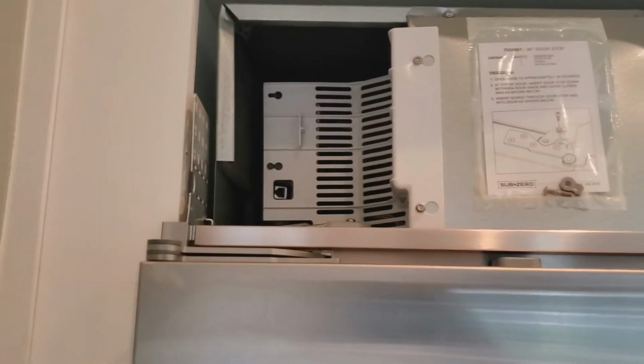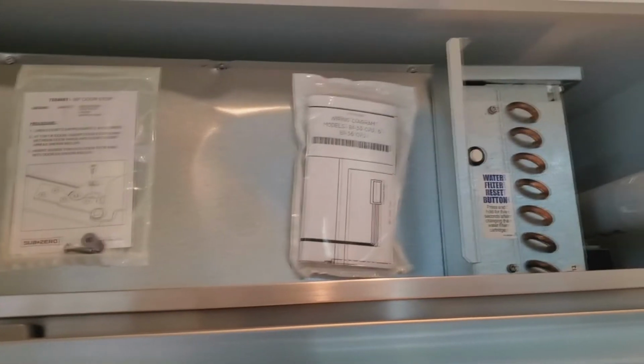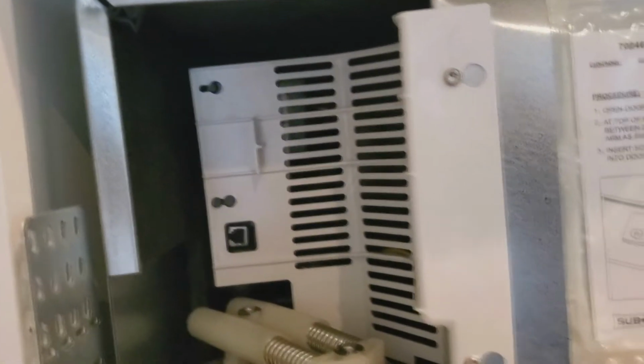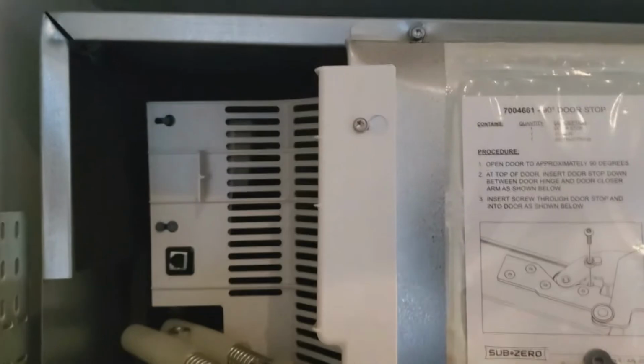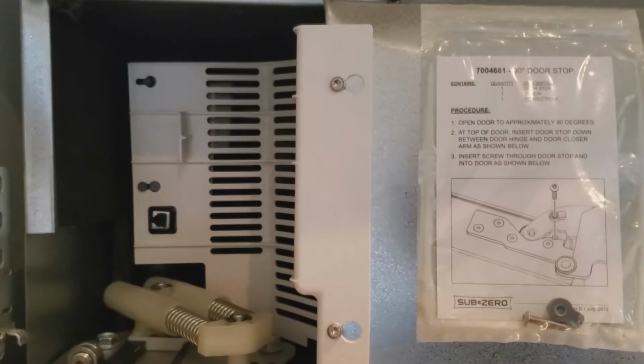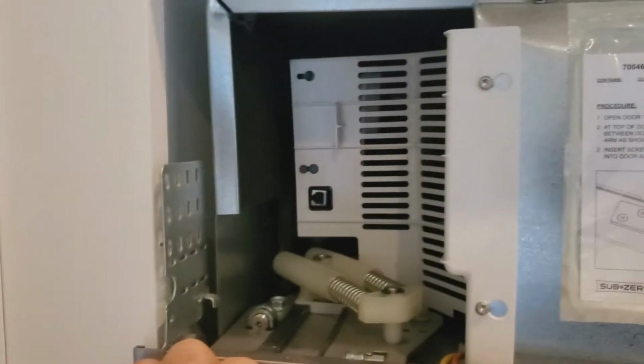The control board is back in there behind that plastic cover. We're gonna take that off. We're gonna get in there and swap this out. That is a little tricky. They've got a bunch of wires going to it. It's definitely, you just got to be careful and take your time when you do this. I would definitely plan on at least, if you've never done one of these jobs before, plan on like a 3-hour block of time. You might use all that time, you might not, and it all depends.